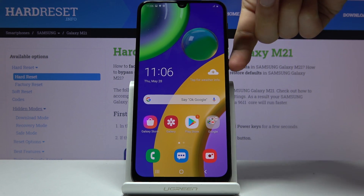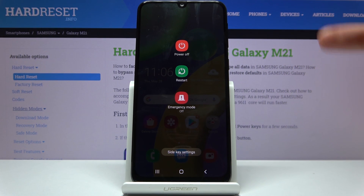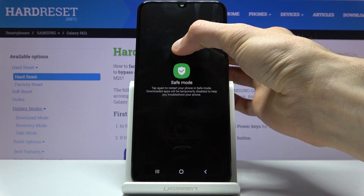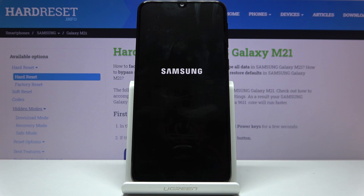To get started, hold the power key and when you see the boot options, hold Power Off. Hold it for about a second or so and it gives you the safe mode option. Simply tap on that and the device will power off and then back on in the desired mode.